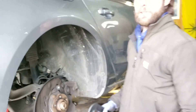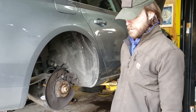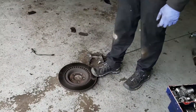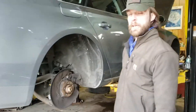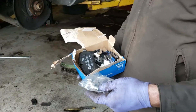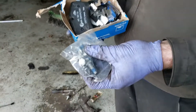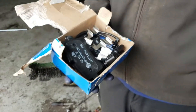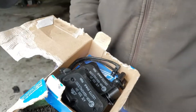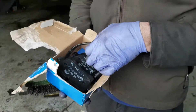That's pretty much it. Everything else from there is just the reverse — put it back together, make sure you clean the surface area of your new rotor with brake cleaner. The OEM brake pad kit comes with new bolts with new Loctite, new brake pads, mounting points, and new sensors.